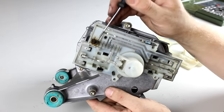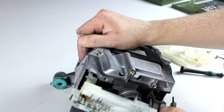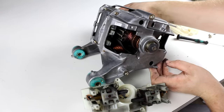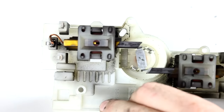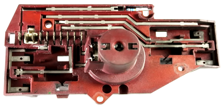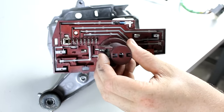We can see that two of the connectors are pretty charred — we'll take a closer look at that in just a second. We can try to wiggle off this entire plastic shield, but you have to be very careful because you don't want to damage the motor brushes that are connected to this plastic part. On the back side of the motor shaft we can also find a small permanent magnet, used in conjunction with a coil sitting in that plastic shield to read out the motor speed. We can now start to determine and write down the pinout of that 10-pin connector, and for that I have taken this picture of another — optically slightly different but electrically identical — shield from another motor of the same type.